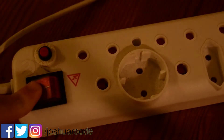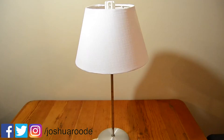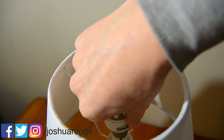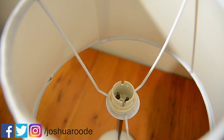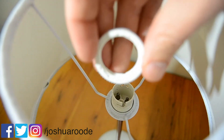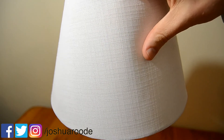What you want to do is switch off the lamp, turn off the power, and unplug the plug from the socket. Now approach the lamp, remove the globe nice and carefully holding at the base, then unscrew the nut that holds the lamp shade in place. Once you have taken the nut off, you can now remove the lamp shade.